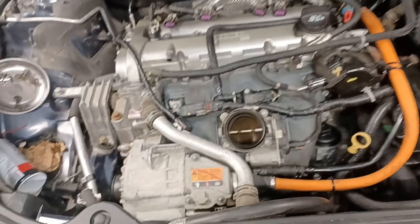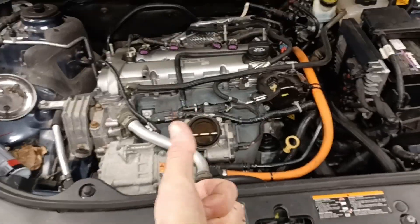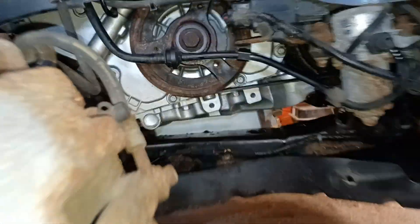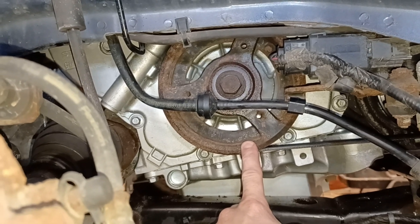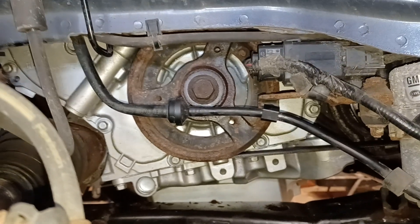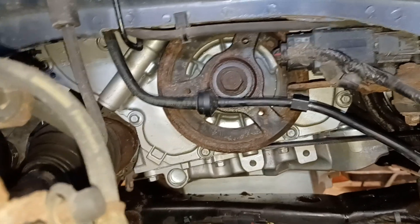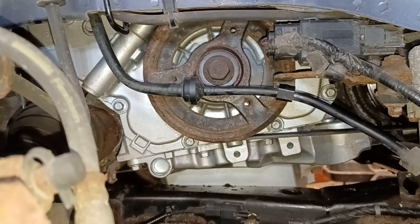I was able to get it out and put the new one in; this is going back together now. Getting that belt back on is very frustrating. Also getting the crankshaft pulley back on — you have to have it in just the right spot. It's kind of like: jack the engine up, move it a little, put a ratchet strap on it and pull it back. This bracket gets in the way and I didn't want to take it off. I got the crank pulley out fine but on the way back in it was harder because I kept knocking stuff and getting dirt on the seal surface — had to pull it back out, wipe it off, put a little more oil on it, and put it back in.